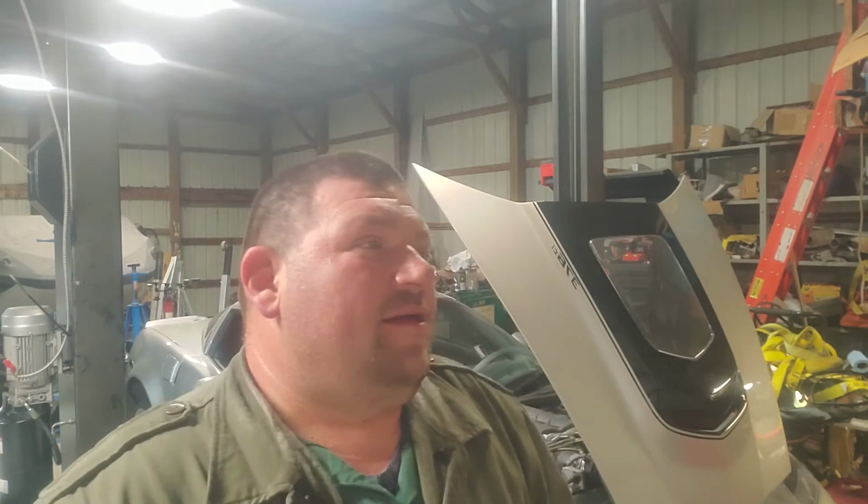Someone talks me into putting a bigger cam in. I think that one was a 242, 256 on a 112. And the heads were totally redone. On the aftermarket heads, the valves were already out of spec as far as the wobble in the guides. So I had them completely redone and ported this time and sent back to me. I put it back together.